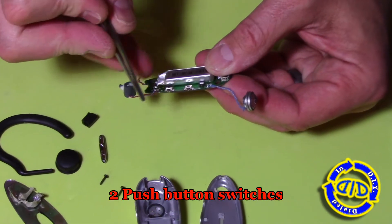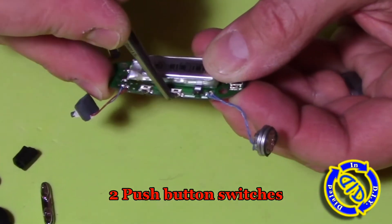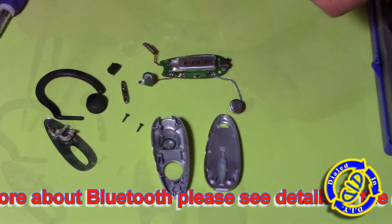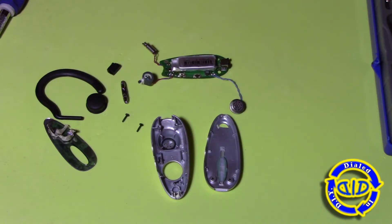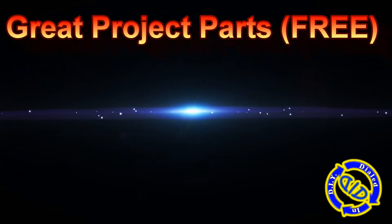This particular earpiece actually had a vibration alert, which is why it had that ERM or eccentric rotating mass motor. That eccentric rotating mass motor is basically a little vibrator, and I'm going to show you more about that in just a minute as well. Now you see here are all the primary parts — that's where the power connects, these are the two little push buttons, and you can see the speakers up front as well as the mouthpiece and that rotating motor.